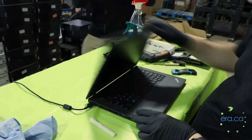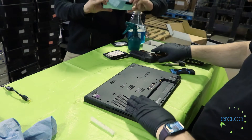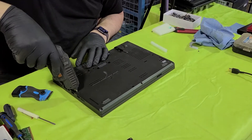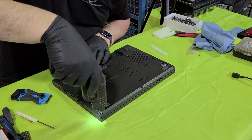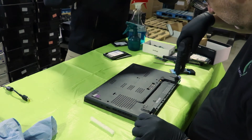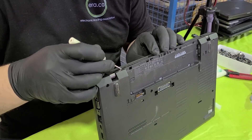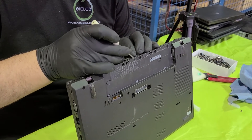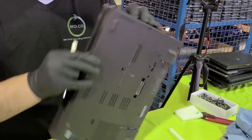Let's just power it off and open it up. Now this is a bit more tricky because there are a lot of screws. We are going to use the drill. You should know there are no hidden screws on this unit. Now these screws will not come out all the way. We are going to use a flat head screwdriver to detach the back cover, and we are going to have to gently pop this out without breaking the plastic tab that is holding it.